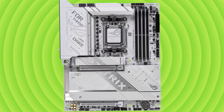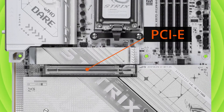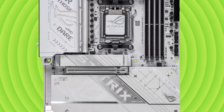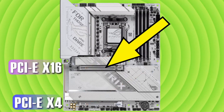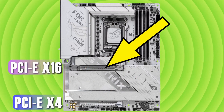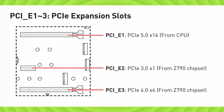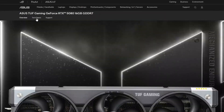There are a couple of really important things you need to know before you start installing a GPU in your PC. GPUs require access to a PCI Express or PCIe slot — these are the long rectangular connectors on your motherboard. Some motherboards have multiple slots, but they're not all equal in terms of performance. Typically the top slot is where you want to install your GPU because it has full unrestricted access to the PCIe bandwidth.